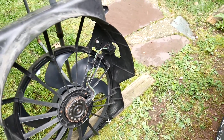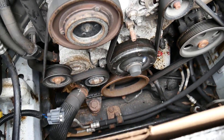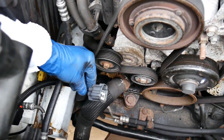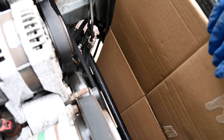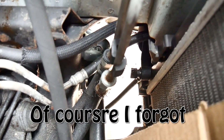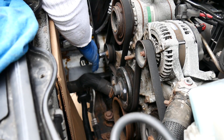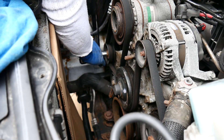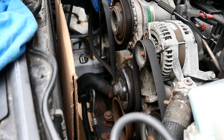I need to unplug the harness to the fan motor. Now you can see we can get to the water pump. What I like to do is put a piece of cardboard up against the radiator so when I'm working around with tools I don't bang into it — plus it also protects my arms from getting cuts. Now would probably be a good time to tighten up that petcock down there because it's a little pain to get to from the bottom. To get the belt off, basically all you have to do is loosen up on the tensioner with a 15mm, put pressure on it, and then you can remove the belt.